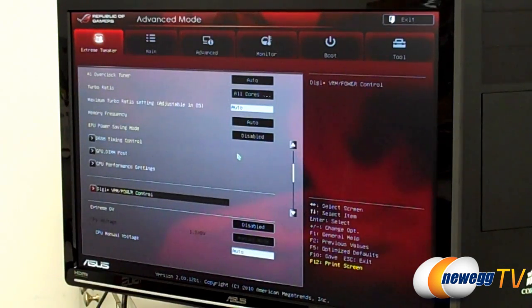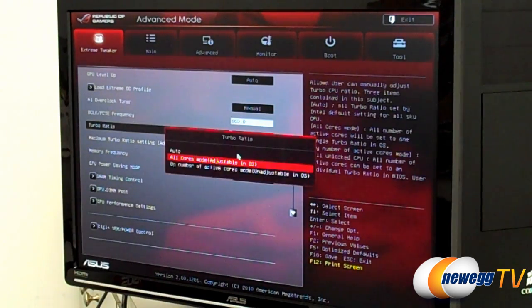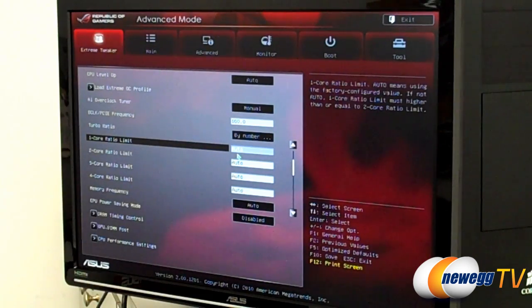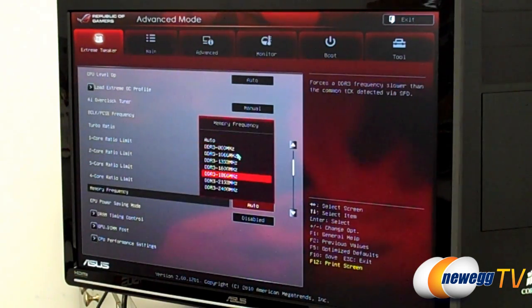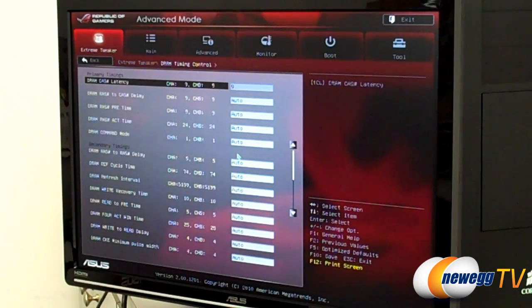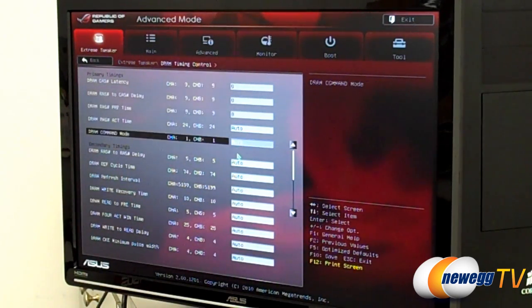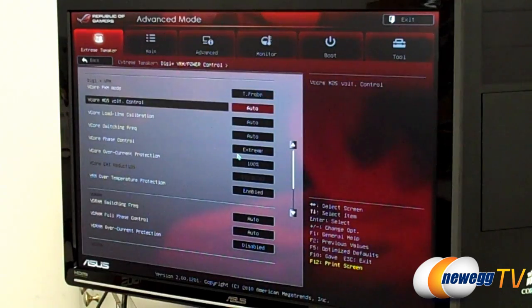So here we're going to focus on just a quick overclocking. We're going to jump into the AI clock overclock tuner, go to manual, go to all cores. I think we were shooting for five, but I think we're going to try to go a little bit higher — 52 multiplier, maybe 5.2 gigahertz? That sounds good. So let's go ahead and do 52 — 5.2 gigahertz on air? Yeah, it's an air cooler. We'll go ahead and go with 1866 on the memory, since we don't want to super stress the IMC — as we know the higher frequency we go, the harder it gets to also maintain high memory speeds. We'll also tighten up the timings a little bit, go CAS8. And let's go ahead and enter our Digi VRM options.